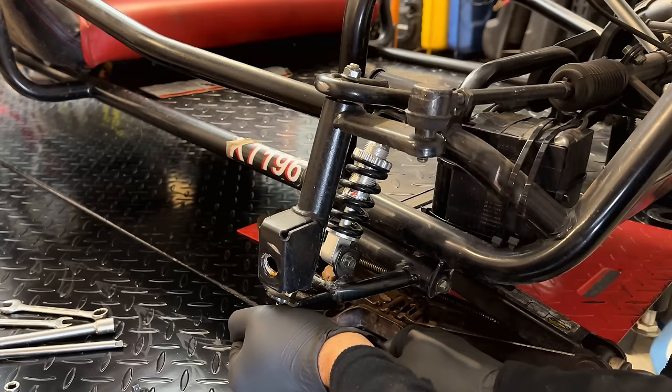Fits on there pretty well, but we do have a problem. I was kind of worried about this right here. Although this has the same footprint as the original engine, it was fairly close to this bar right here. And once you add on this control panel, we're now within about a third of an inch, which would be fine, except for the fact we have suspension right here. So every time we hit a bump, that control panel is just going to hit that bar. It's going to limit the suspension and eventually destroy that. So I had wanted to keep controls both on the back and the front, but given this interference here, I think we're going to have to eliminate this and just go with the controls in the front, which for the most part's fine.